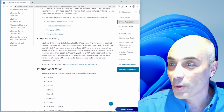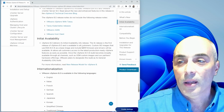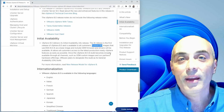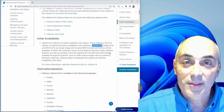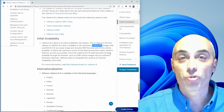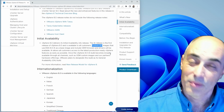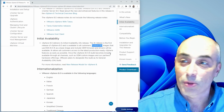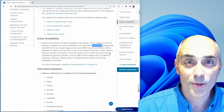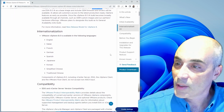So without further ado, first thing you need to know is when you download these things, if you're using a Dell, go ahead and use a custom ISO image. In my case, I've got a Dell, so if you download the one from Dell, you will have the built-in drivers that you need for that hardware. It automatically can find the RAID controller and the NICs, or network interface cards, that you have on there, and you've just simplified your life. So that's one way to do it.